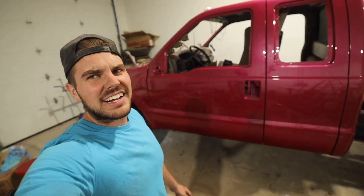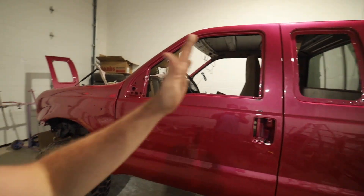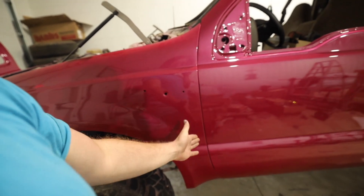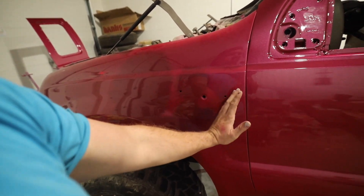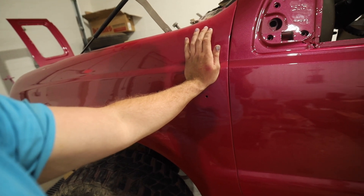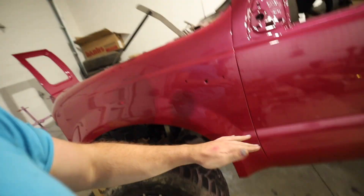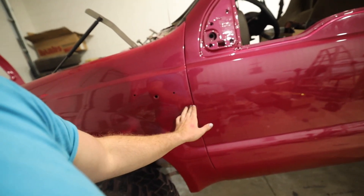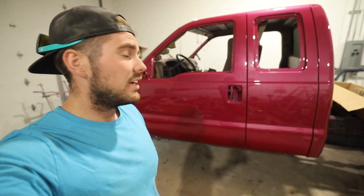Guys, look at that - Ashley and I got these doors on, got them all aligned. On these Fords it's actually quite interesting. They don't really tell you what to do to get the doors set. So the fender - I know a lot of you were like, oh you should have put the fender on after you put the doors on. Yes, I realize that gap is super tight here. I need the little plastic clip retainers to get that to actually get in more, and then these can loosen and I can push it forward. Same thing down there, needs to go forward just a hair because this gap is really tight. These doors though, that's a better than factory gap. And plus the pink all in one, this looks good.